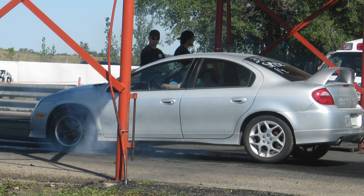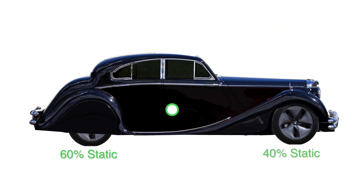This is a problem with front-wheel drive cars, because as soon as you hit the gas, all the weight transfers to the rear off the driven wheels. When you're slowing down, all your weight shifts to the front. So if you start with more weight on the rear tires, your weight distribution gets more evenly loaded as you slow down. So in braking, you want more weight on the rear. In cornering, you want 50-50. And if you have a rear-wheel drive car, you'll want a little more weight on the rear tires for traction. So two out of three times, rear is better. If you're always driving in a circle at a constant speed, then 50-50 is ideal — but if you ever plan on slowing down or accelerating, a rear weight bias is better.